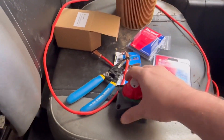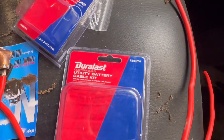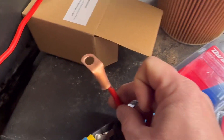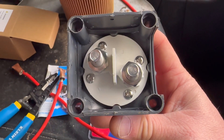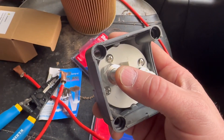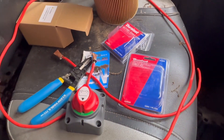What I've decided to do — I'll show you where I'm going to mount it in a minute. You take one large cable; I've got an eight-gauge utility battery cable from AutoZone, about six foot long. I had to add some larger eyelets than what it came with — soldered them in place. You'll take one and go from your positive battery terminal to one side of the switch, then take the other side of the switch and run another cable to your original battery cable. I've got my other accessories tied into that with eyelets as well, so they'll all be tied in there.